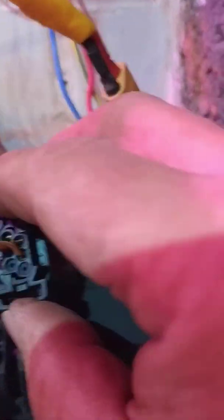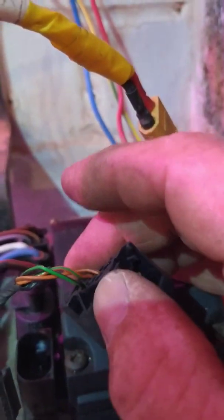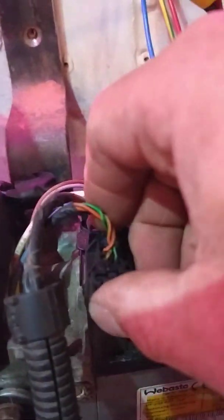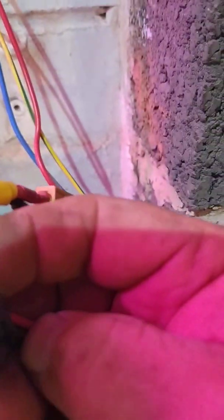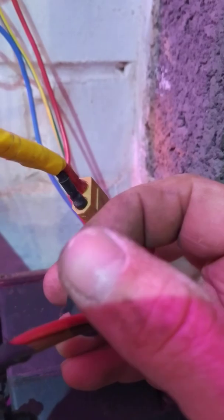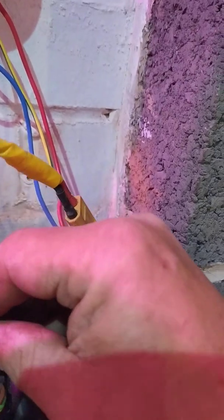That orange and brown pin two wire goes to a switch and then straight to your power supply, your battery or whatever you're going to use. That orange and green wire is not needed - it's something to do with diagnostics, so it's cut off in the loom. Then you've got the main heavy duty plug which fits in there. The red wire is the main positive - that's always live, and the black is always negative. There's no switching on that one.